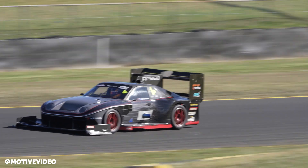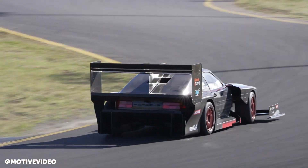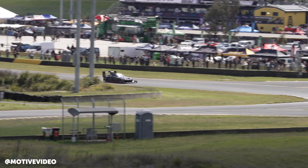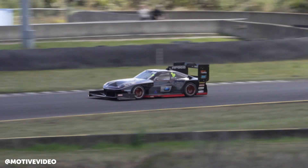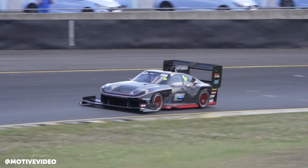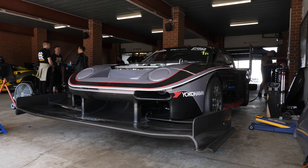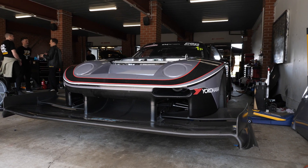We've found some gains by increasing the spring rate and taking some packers out to effectively give the tyre more contact under braking. We were seeing low-friction points where the ABS would be stabilising the car but not effectively slowing it. Essentially the car was bouncing and the tyre was not contacting the ground, so the ABS does its job stopping the tyre locking but it's not really slowing the car down — and that's exactly right.